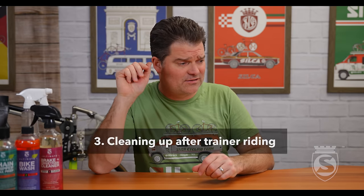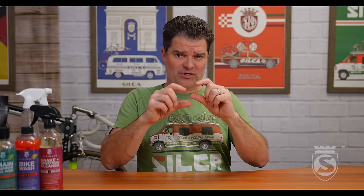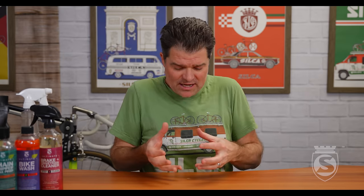Number three: trainer riding. There's not a lot more I can say — riding the trainer is absolute hell on your entire bicycle and torture on the wheels. Most wheels on the market use a carbon or aluminum rim, an aluminum or brass spoke nipple, a stainless spoke, and an aluminum hub shell with stainless bearings. When you're sweating, the headset and stem area take the bulk of sweat, but so much of it comes down the fork onto the wheel and down the fork legs into the hub — and you have a recipe for a galvanic nightmare.